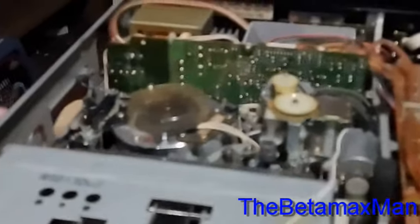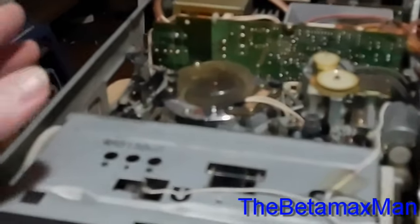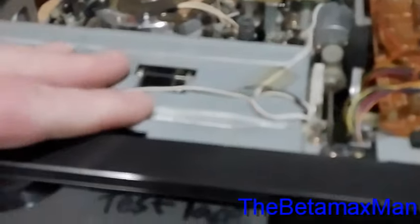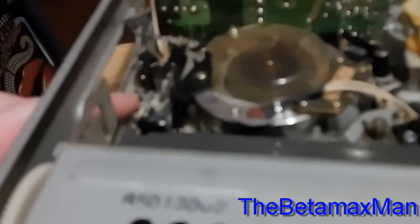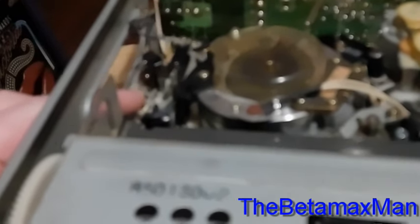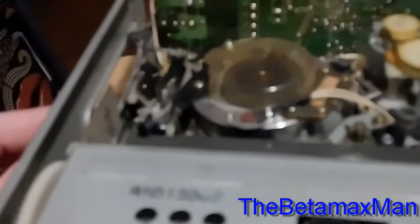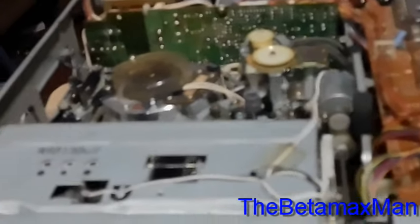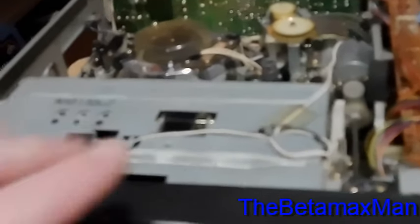Let's see why our switch isn't working — I'm going to show you one more time what's going on, where the switch is not fully being engaged. It's not being fully pressed. Take a look at my finger here — you'll notice that it moves over, but not far enough to engage the switch so that it will complete the cycle.